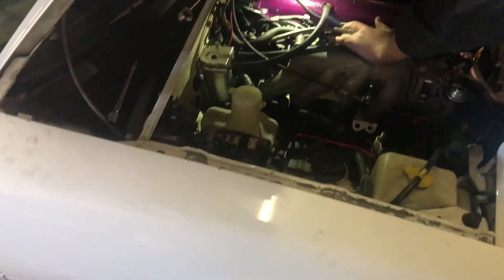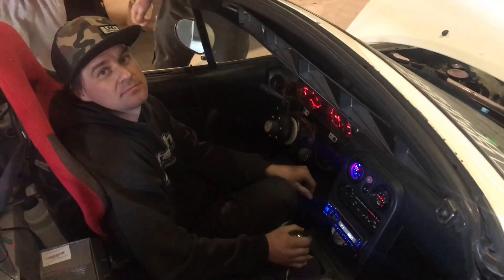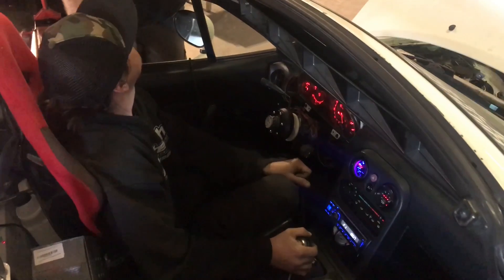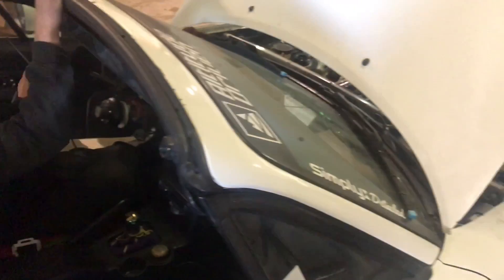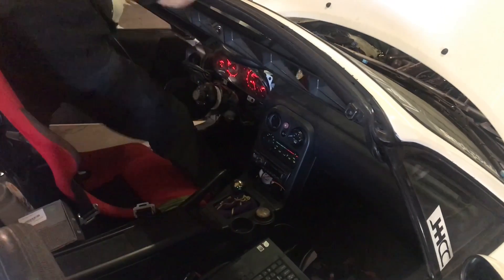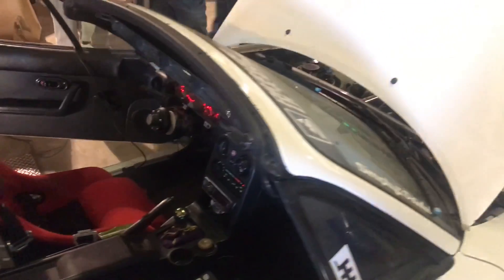That's why it revved up a little hard when you got off of it. So there's one vacuum nipple that came off, and there's a coolant leak at a hose — it's just got a little pinhole spraying. That's why it went all fat mode.